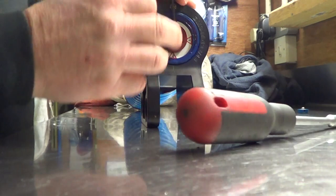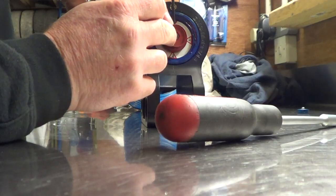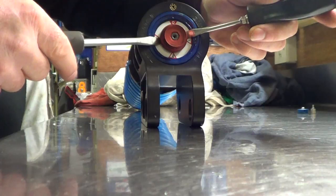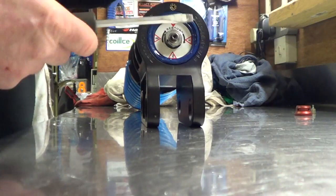You're not de-gassing or releasing oil. This little allen key on the end is what does the adjusting in there. You don't want to adjust that adjuster out too far, otherwise you can cause problems, but if you don't go past the flush point you can't cause a problem. So the adjuster stays to the side. Now that leaves us for our 2 straight heads to remove the red rebound adjuster. Catch it both sides and just rock it side to side and it will pop out. Sometimes it can be quite tight, but just keep rocking it back and forth and it will pop off.